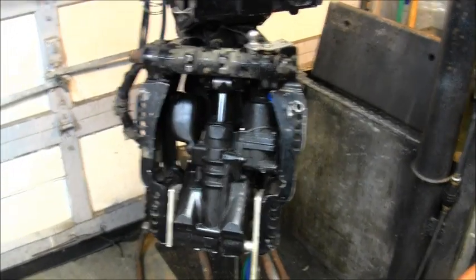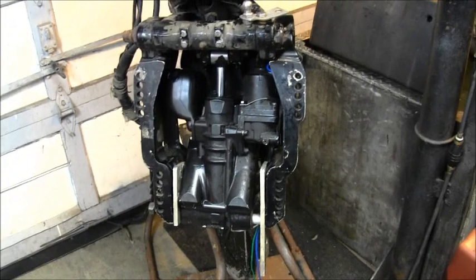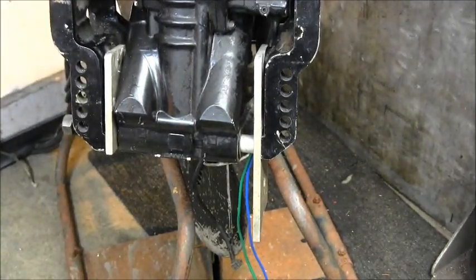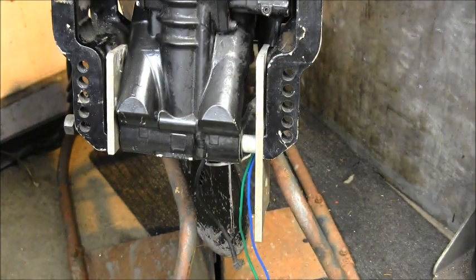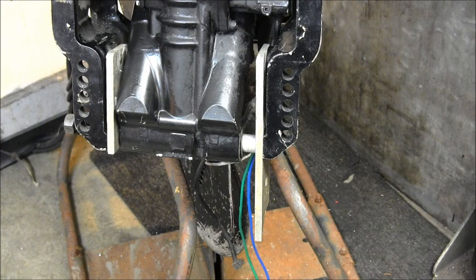All right, that's kind of what I'm going for as an end product, minus a couple of bushings and maybe washers. You can see, yeah, I gotta cut that piece yet, right there. That piece. But you can see this fits in there pretty good. I might want to put a washer or two there. And I got my Sharpie and I'm drawing my lines so I know where to cut. Then it's a matter of cutting it with the jigsaw, tapping those bolt holes, and putting the big bolt all the way through and the bushings in, and then I'll deal with the top, which I think will be a lot better and more simple for sure.